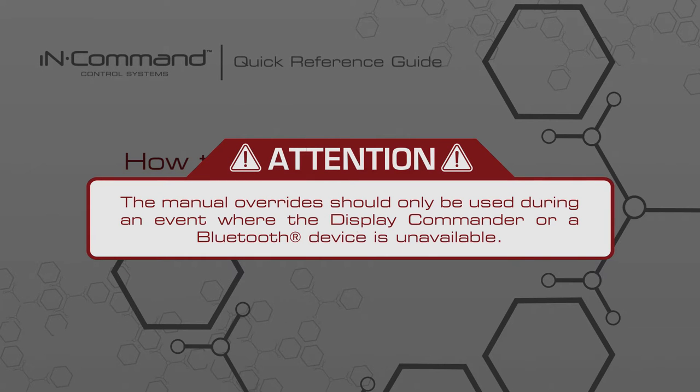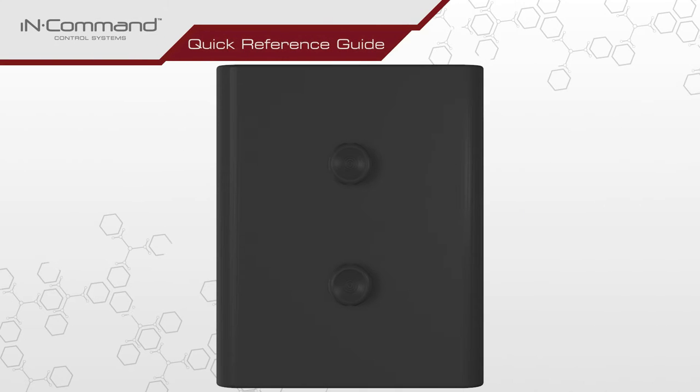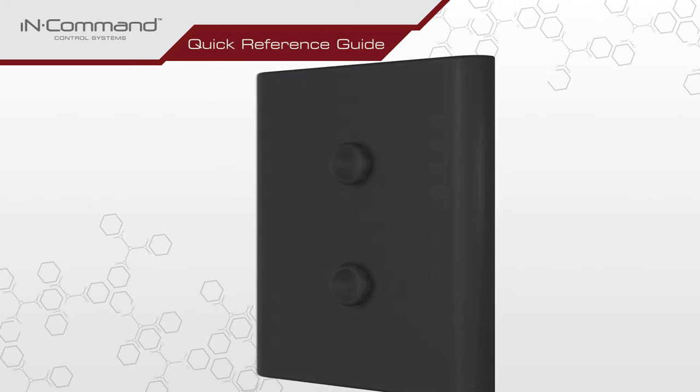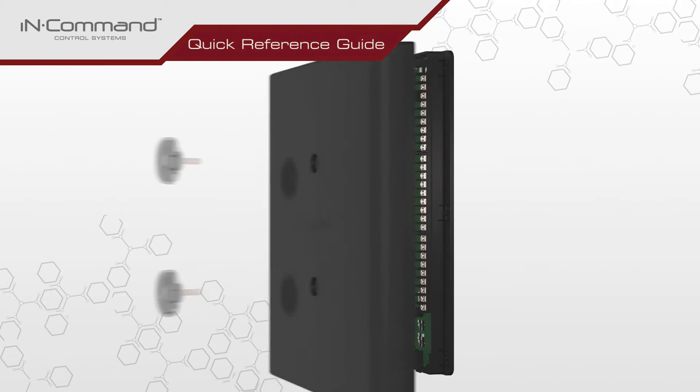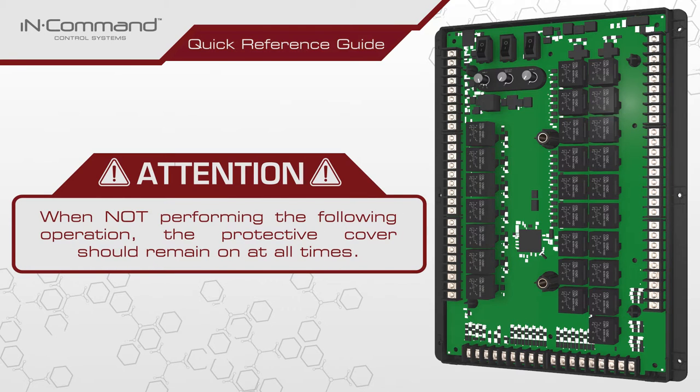The manual override should only be used during an event where the display commander or a Bluetooth device is not available. To gain access to the manual override controls, go to the body control module and carefully remove the protective cover. When not performing this operation, the protective cover should remain on at all times.